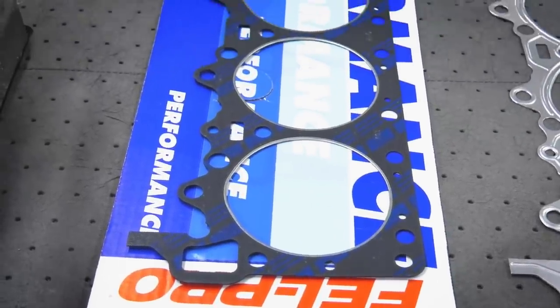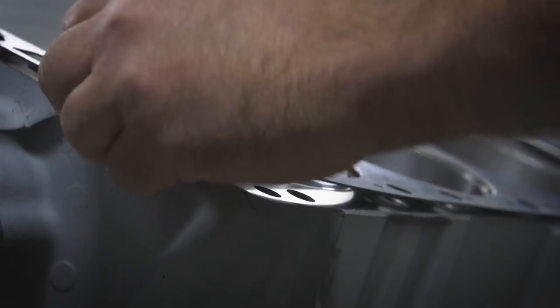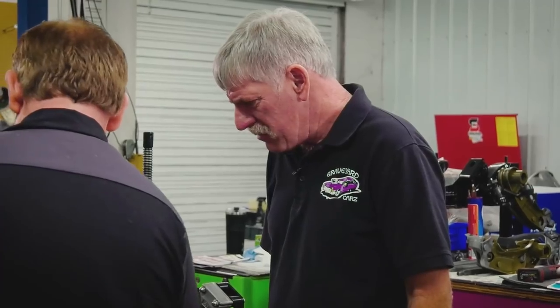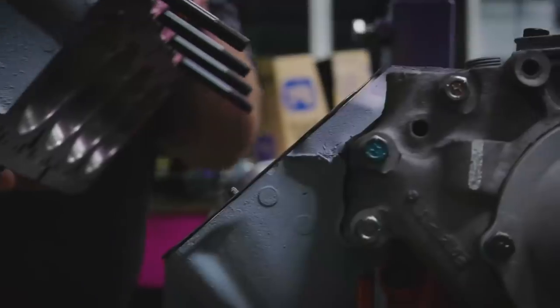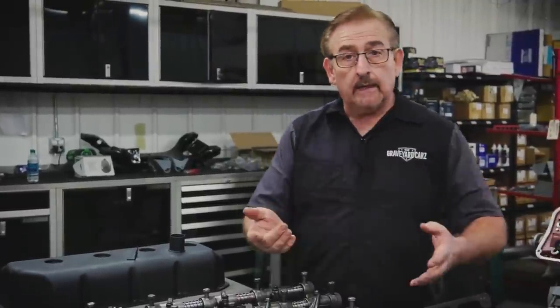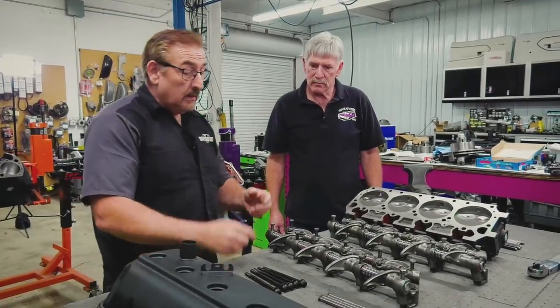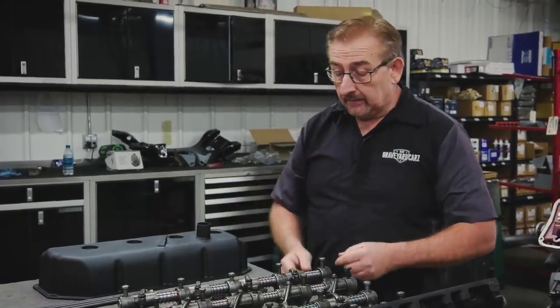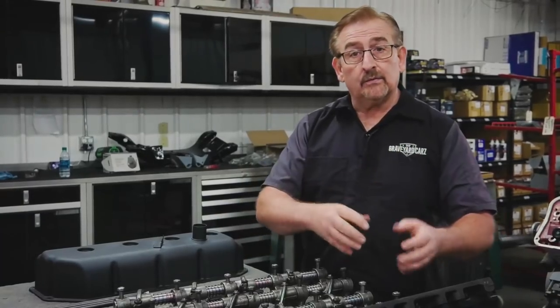With that, let's take this over and put a cylinder head on this engine right here. After checking the gasket, they lift the head onto the 426 Hemi. Before you can torque the head down on a 426 Hemi, you have to have the rocker shaft assembly in place — this is different than a wedge engine. On a wedge engine, the rocker shaft can bolt in after the head bolts are in place. But on this one, the actual head bolts go down through the rocker stands — five of them anyway — and then the rest of the bolts and studs go into place.